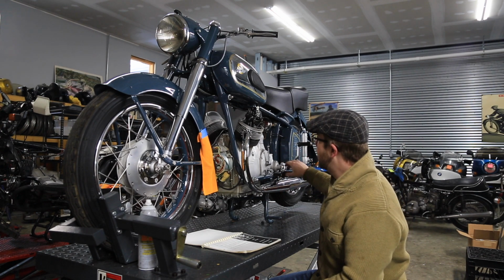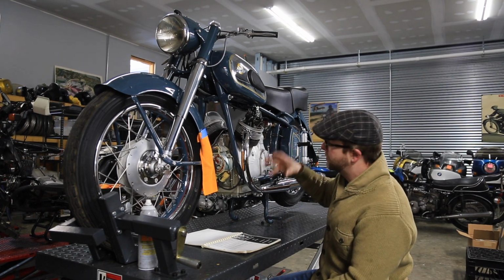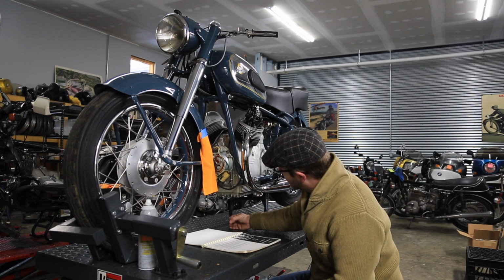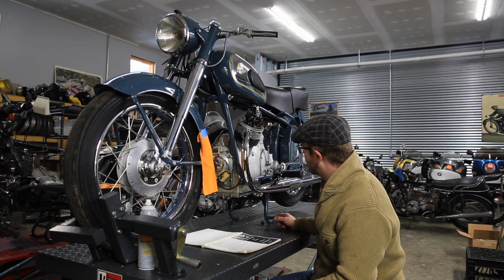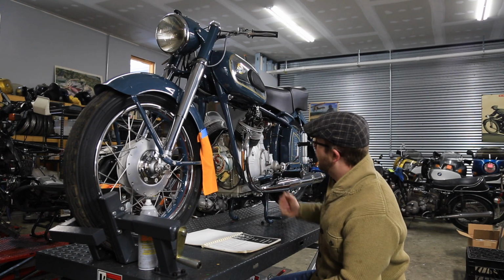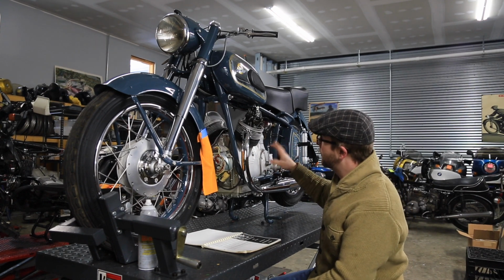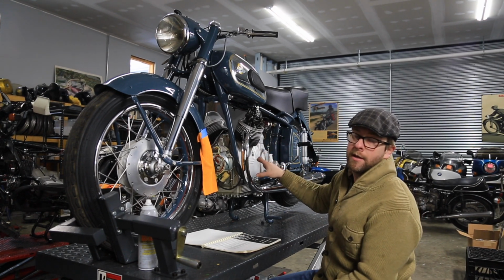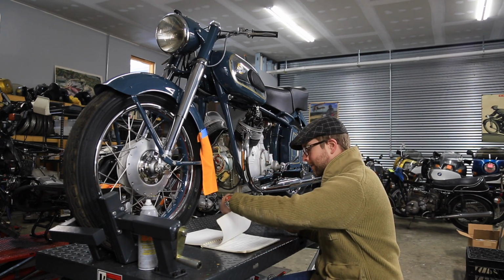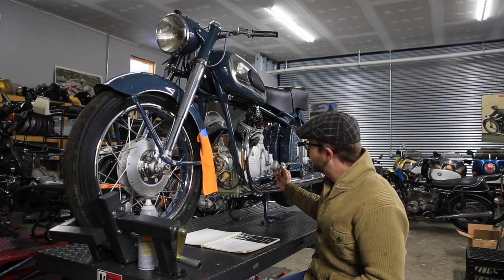We'll start the motorcycle and you can kind of see what's going on with the oiling system. It's also building, I think, too much pressure and blowing oil out through the bottom of the crankcase vent, and it'll create a puddle here on the bench after it's run for a short period of time. So I think all of that will be rectified with checking the breather. It's possible there's a blockage inside of the engine. I'm really hoping that's not it. I really do not want to tear down a Victoria Bergmeister V35 engine with this poor workshop manual that seems to be the standard for everything. So we will see what we've got.